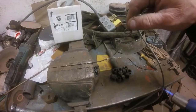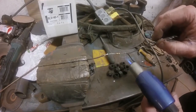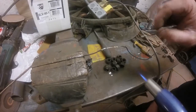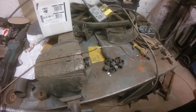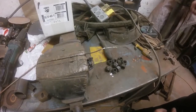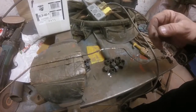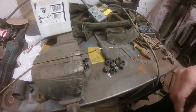So we already soldered this piece on right here — it's simply two little wires. It works great with a soldering iron. What we're going to do now is we've got a bit of wire on so we can run it to our switch live. We'll put it with heat shrink and tape it up to protect it, because you wouldn't want it to ground out anywhere.